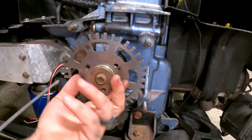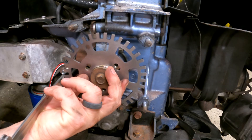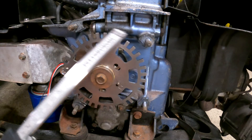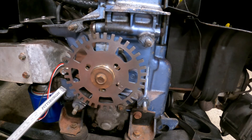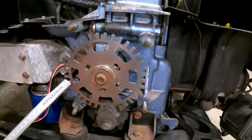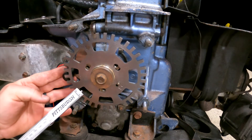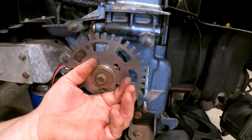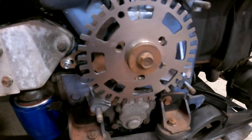Now we're looking at 2.77mm. The closest position is going to be best because this is really critical to engine running. I'm going to pop these nuts off, make sure it's all the way forward, and put some Loctite on it. I also need to make sure I have the correct orientation of this sensor — I've never used this kind of sensor before in any installation. I'll confirm it's positioned over the teeth correctly, check that it rotates flat with no chance of contact, then apply Loctite and lock it down.